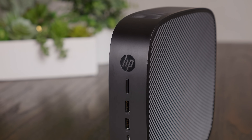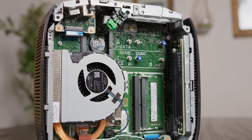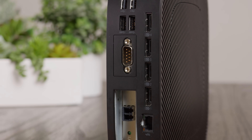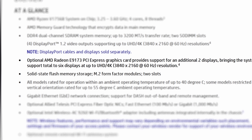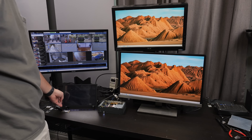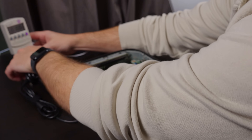This little guy might not be relegated to home lab duties though. With the Ryzen chip and Vega graphics, this could work really well as a thin client remotely streaming from another system, or even functioning as a simple desktop. It does have four DisplayPort outputs, and according to HP's docs, they could each support up to 4K60 — so this might even be a fairly cheap little machine for a multi-monitor productivity setup. There's only one way to find out, so I got this thing plugged in and booted up.